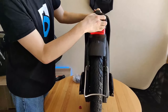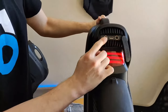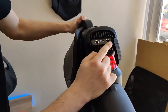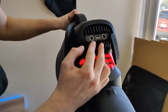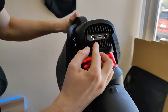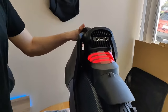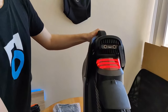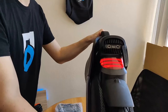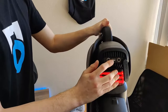Let's take a look at the charge ports. They're located back here, and we can see dual 3-pin charge ports. If you get two of these stock chargers, that will let you charge up to 3 amps. But with fast chargers you'll be able to charge even faster — InMotion has upgraded the internal charging wiring to safely support up to 5 amps. If you get two 2.5-amp fast chargers, you'll be able to pump 5 amps into this wheel and charge really quickly.